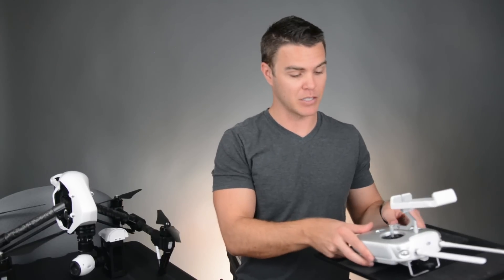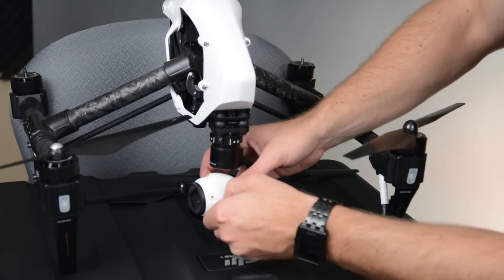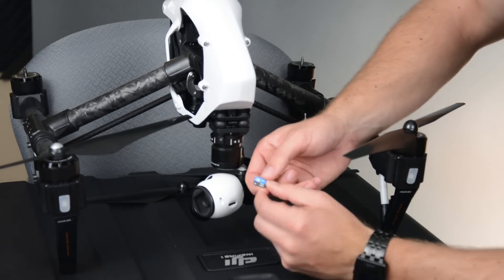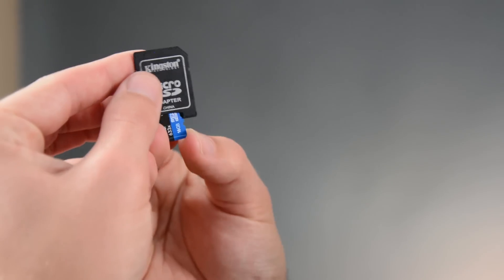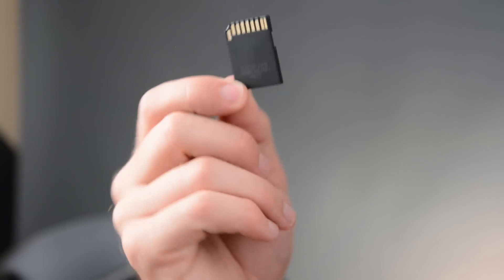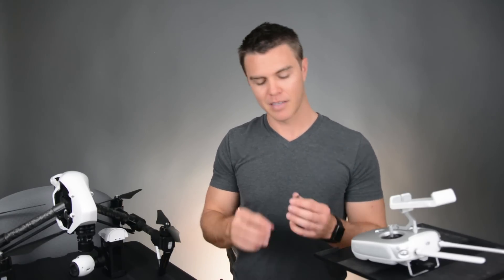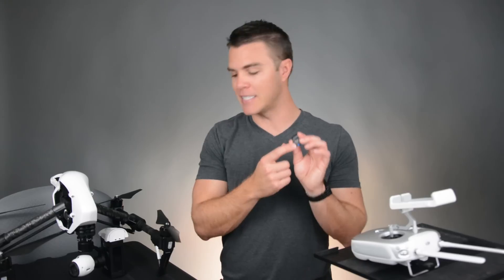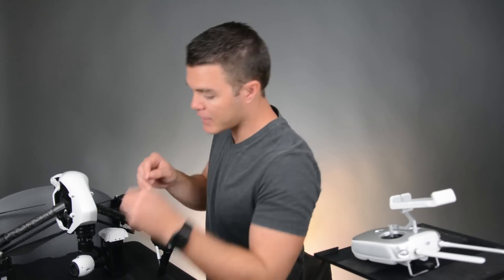Next, on the camera there's the slot for the microSD, so we're going to pop that out. I have a microSD adapter that I use to plug into my PC. We just put that in, and then the same thing is going to happen — you're going to take the same .bin file from the extracted zip file, put it on that microSD, and once it's on there, plug it back into the camera.